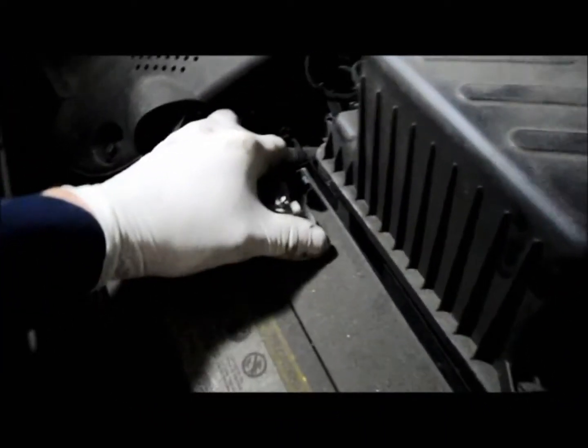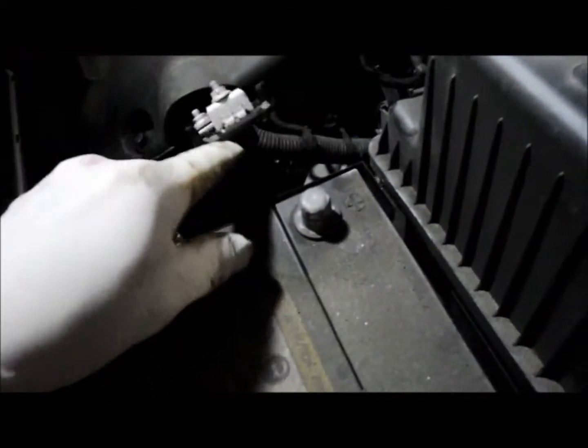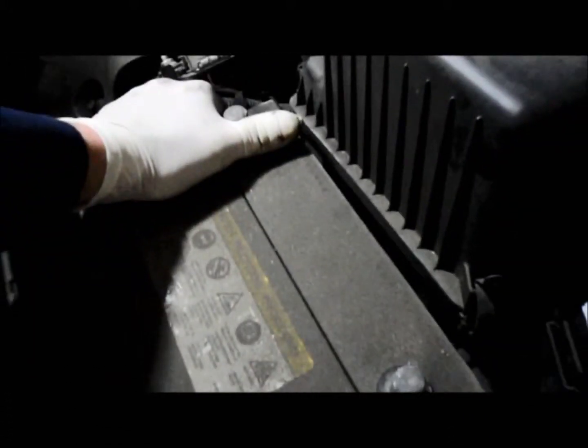Then what we're going to do is pull off your cables. Take your negative cable off first, reposition that out of the way, then take your positive cable off. Remember, be careful when you put this down because we have the battery box connected up to it inside. We're going to take this cover off and then remove the battery.